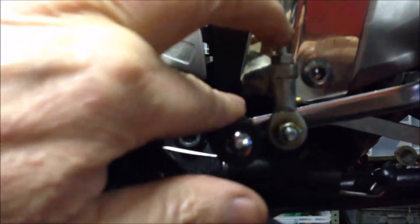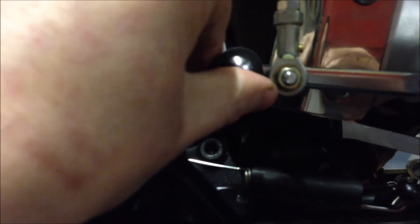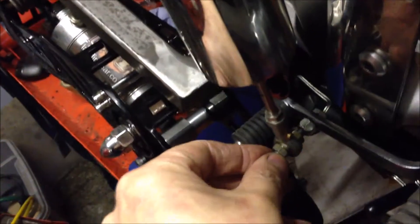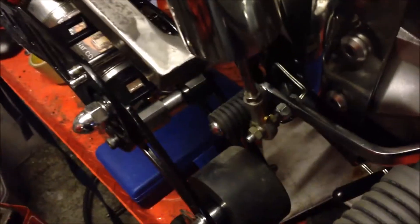What you've basically got to do is work out that the Clicktronic has to have 25mm of movement. You can see what we've done is marked the actual full movement mark, and then just taking 25mm in the middle of it. As you can see, that's going to change gear perfectly okay. You want the bar here to be completely free, so what we've done is just spaced it out using a series of nuts, drilling a hole in the original gear stick.